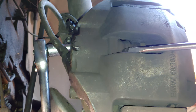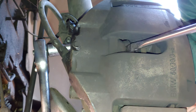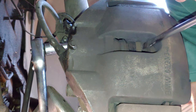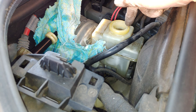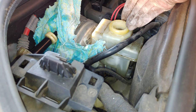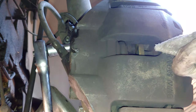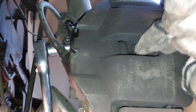The new disc is a bit wider, so I want to separate the pad from the disc to make fitting the caliper easier. Be very careful — there's a piston and a rubber seal there so the oil doesn't come out; don't go anywhere near that area. I'm wedging a screwdriver only where the heat dissipation area is. Open your reservoir cap because when you depress the piston it pushes the oil back up and you need to release that pressure. Wrap the screwdriver in a cloth and gently depress the piston.